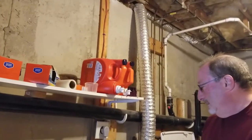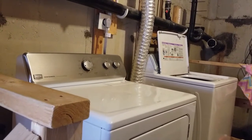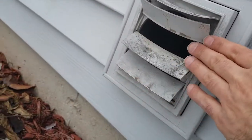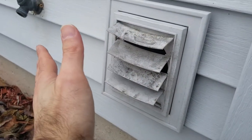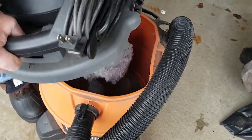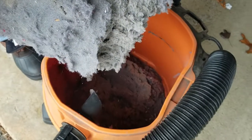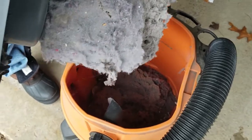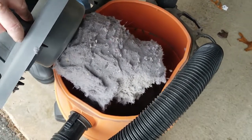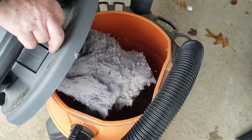We'll go to warm up and make sure everything is functioning. I'll take a walk outside and check the duct — you can see we've got some dust that blew out, so we'll get that cleared. We've got good airflow, which is definitely a good sign. Let's take a look at how much lint and dust we actually got out — we cleaned the container before we started this process. That's how much lint came out of that ductwork. That's probably what the problem was: there was so much in there it was blocking airflow, and it led to that over-temp condition which tripped the safety fuse.